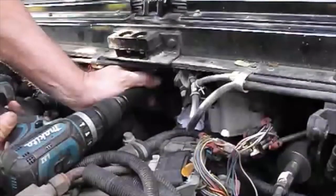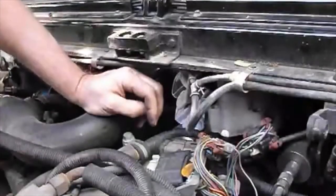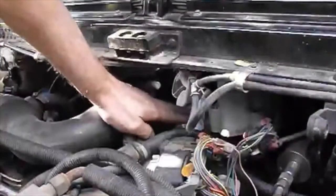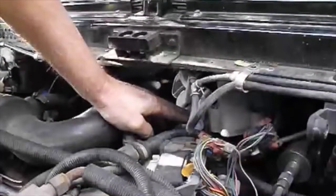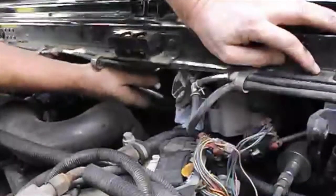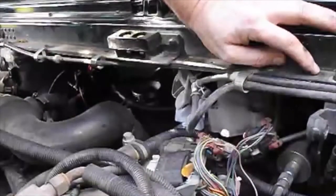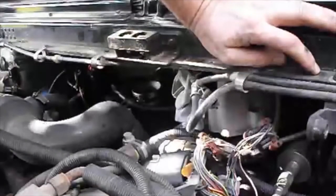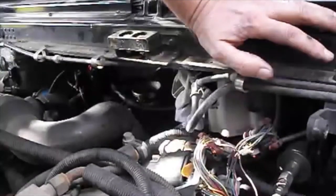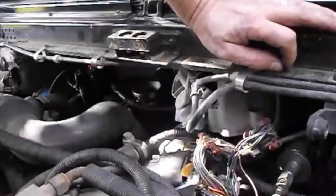So you're going to drill and then remove the bit, and you're going to have some compressed air standing by. You're going to see the rag that's in the hole — stuff that hole with a rag, then drill a little bit, and blow that hole out. Blow that hole out and then drill some more, then blow it out again, and drill some more — just keep going through that process. What you're trying to do is get all the metal shavings out of that hole before you break through for that final time.